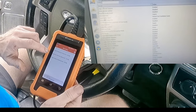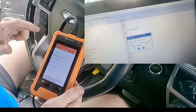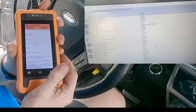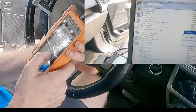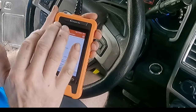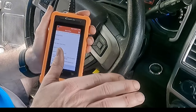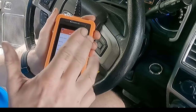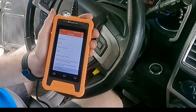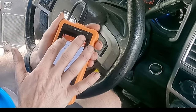You can configure your audio — yeah, the fake engine noise. Mine's turned off. This is really a neat thing, and it does full OBD2 diagnostics and also live data, which has been very helpful. I had a bad oxygen sensor on here and I was able to read the voltage and how it was, the fuel trim. It was very informative, and you can record all of the information right on the device too.